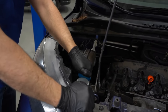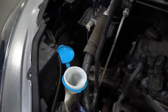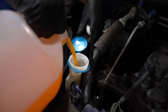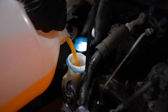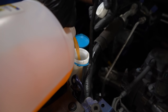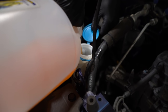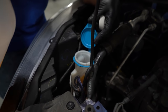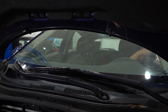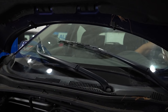Take a look at the washer reservoir — it's right here. You wanna make sure you fill this up with washer fluid. The washer fluid could just be low, or if the mixture isn't correct for wintertime it could even freeze and that could cause this situation. Although the rear pump is working, that's probably not the case — and that's another good indication of why you should check the rear pump. So that's full now. I'm just gonna test it again to confirm. Turn the key on and hit the switch. And still nothing.